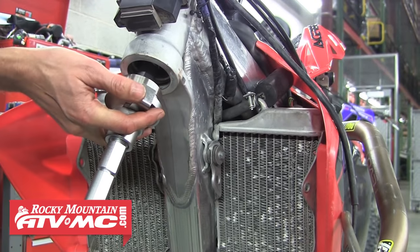Put a little more grease onto the bottom bearing and the top race, then install the steering stem back into the frame. Slide the top bearing down into place, install a new dust shield, and thread the spanner nut back onto the steering stem. Using the Tusk steering stem spanner wrench, tighten the nut down as tight as you can get it, then move it around a little to make sure the bearings are seated in the races. Then loosen it back up and just barely snug it down.